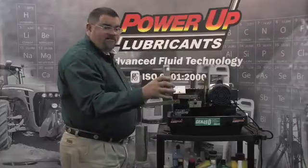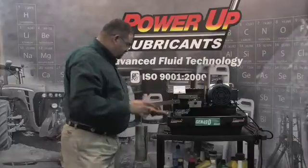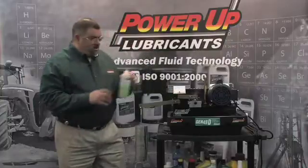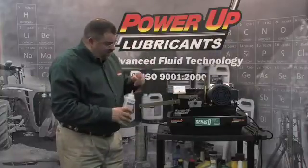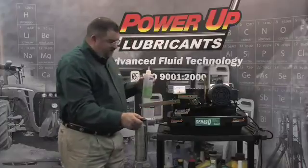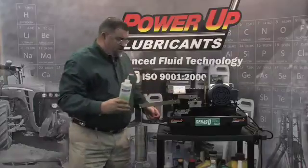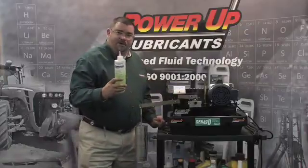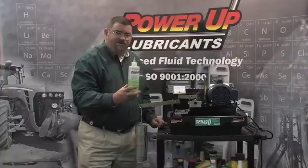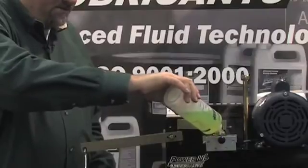We're now at 350 degrees, and we're still running smooth. All of this with absolutely no engine oil at all in the cup. We've emptied the cup out, and we're just running on residual. The third major enemy of motor oil is contamination. This is a mixture of water and antifreeze. Let's add some water and antifreeze and see what happens.